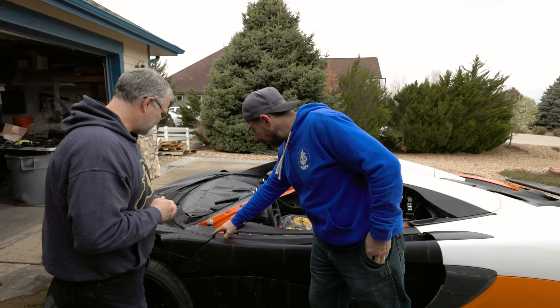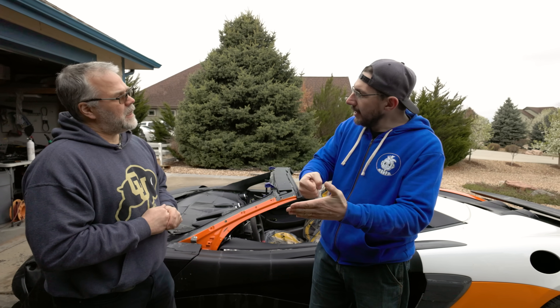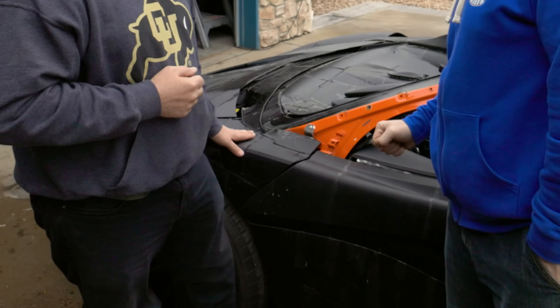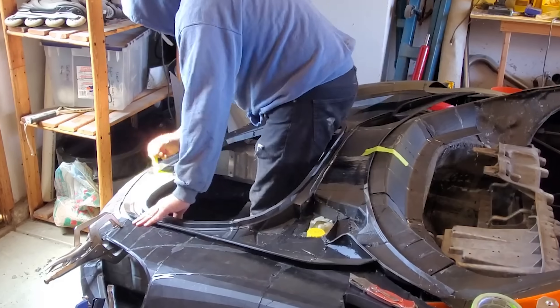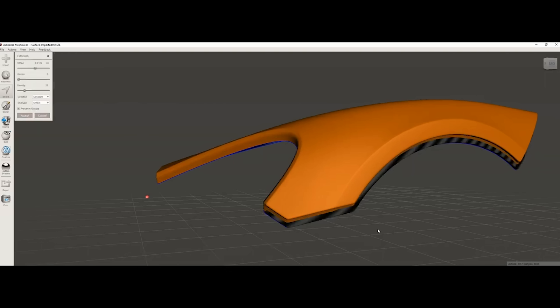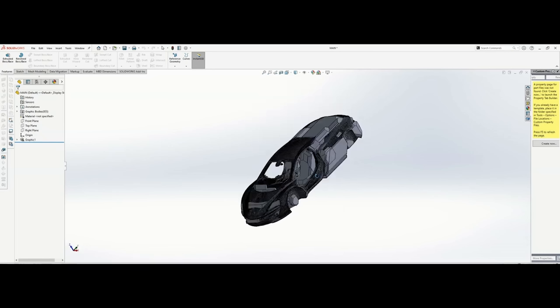Now for the ASA parts, I see some attachment methods here — it looks like a soldering iron with a big flat tip, kind of like a plastic welder. These joiners — the reason I've been using them is I've been getting some cracks in the ASA as I put it on, and I put it under a lot of stress trying to get the panels where I want them. I also have to cut things to try to get it to fit and conform to the car. My model's good but it's not perfect — those are the adjustments I have to make because I'm starting with an actual car.